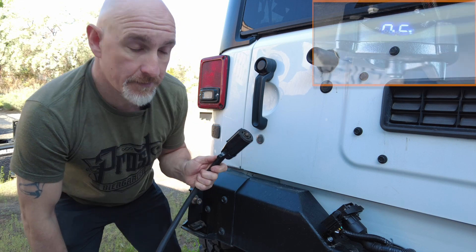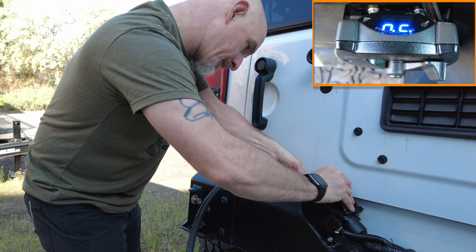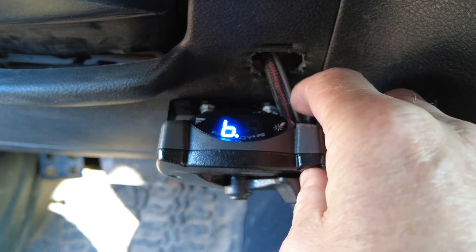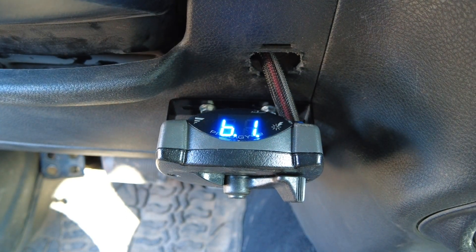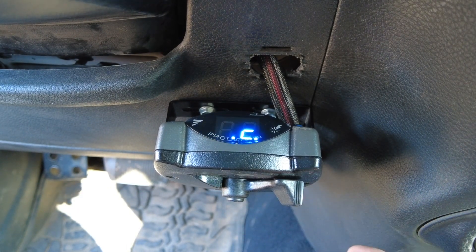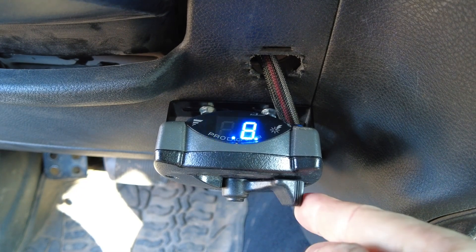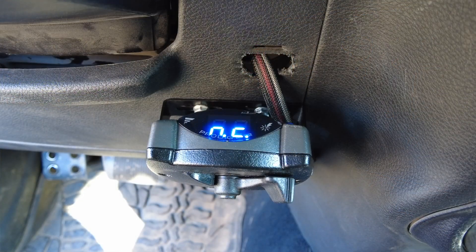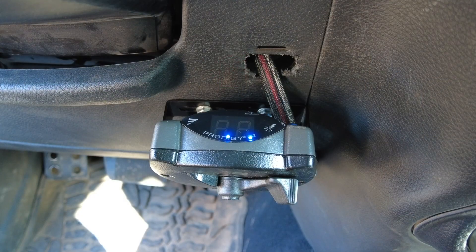Okay, so here's the moment of truth. If I plug in the trailer, I should see it connected on the inside. With the trailer connected, you can set the power of the brakes using the button on the right-hand side. For my trailer it's going to be B1. You can manually operate the trailer brakes using this lever — in true Spinal Tap form, they go up to 11. If you unplug the trailer or the trailer wiring is bad, you'll see NC for not connected. The trailer brake controller is always wired to the battery, which means you don't have to worry about turning it on or off. But when you turn the Jeep off you'll see two blue lights, meaning the trailer brake controller is still on. Don't worry, it will auto power off after 15 minutes.